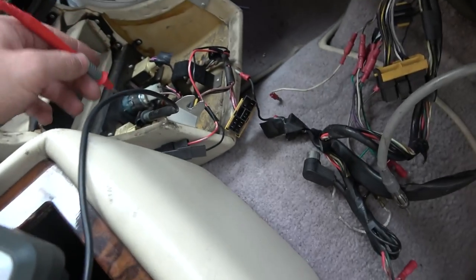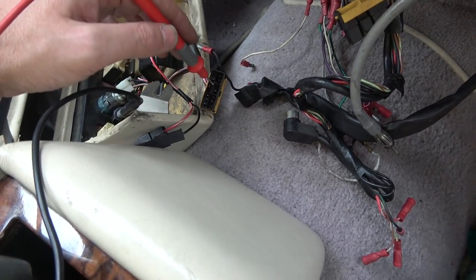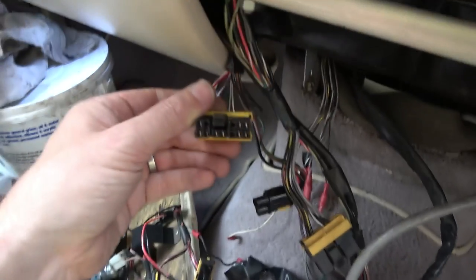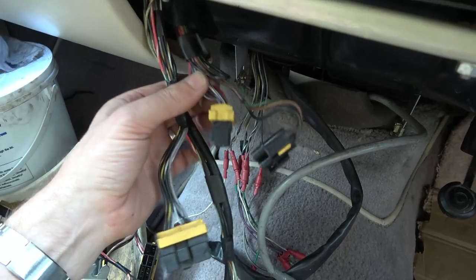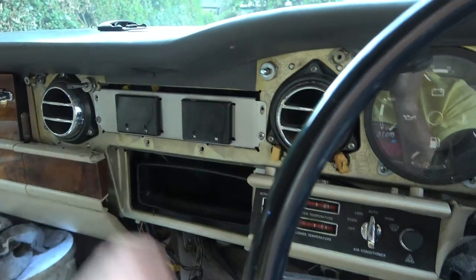The connector looks clean, and from here I've got one probe in there and you can hear it's coming up here. The other probe is coming up here when I swap it over. So we know it's on that wire there and that wire there. So now in here it looks absolutely perfect. There's no bad wire in there. So we now need to find out where this goes to, which should be interesting. I think I'm going to undo this screw and this screw here. It might uncover more wiring.